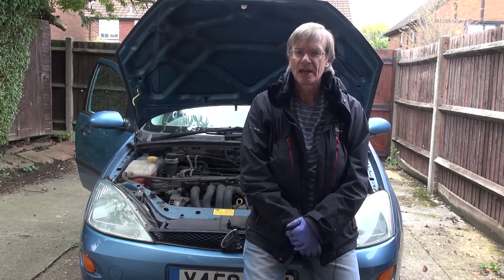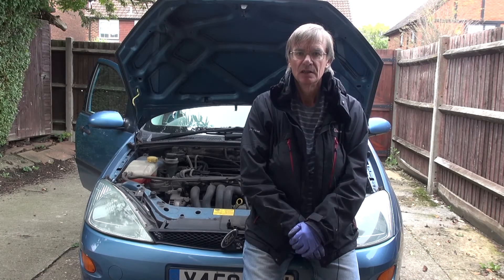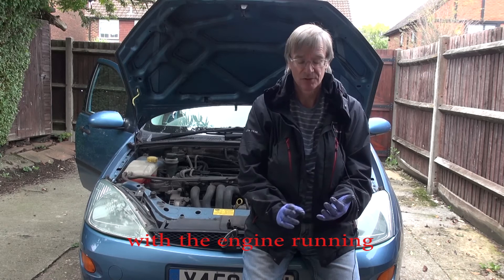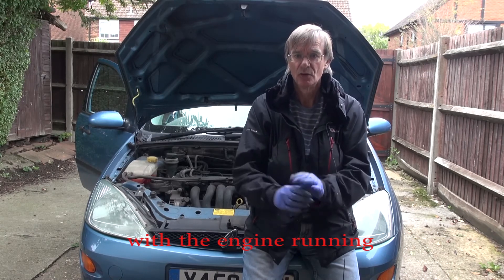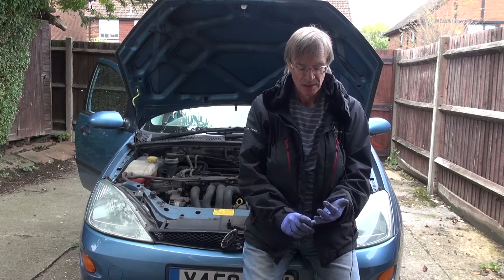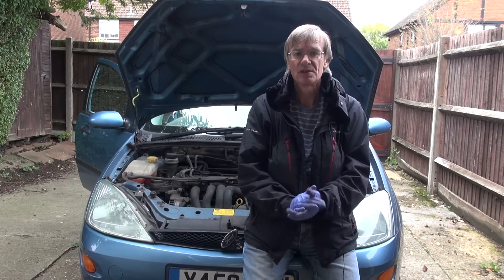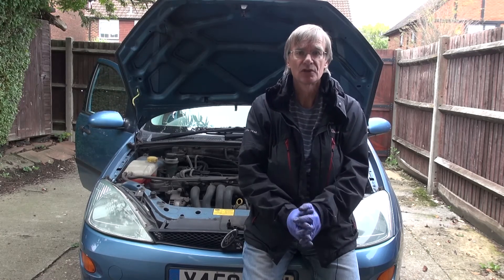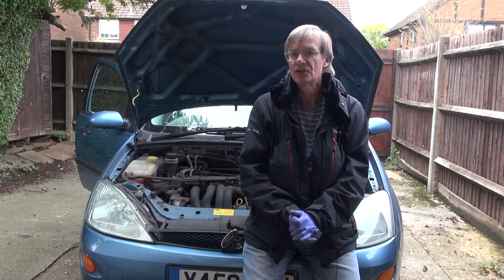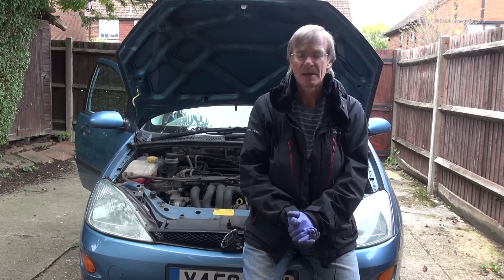There we are — a few quick checks you could do before you change an expensive battery. The first was checking whether the battery warning light is on in your instrument panel. In my case the battery was so flat that as I tried to turn on the ignition all the lights dimmed down. A battery warning light indicates a problem with the charging system or possibly the battery itself. Secondly, put a multimeter across the battery while the engine is running — you want to see at least 13 to 14 volts. If you're not seeing that, the alternator is not working. With the engine off, the battery should maintain at least 12 volts; if it's showing something like 10 volts the battery is as flat as a pancake.